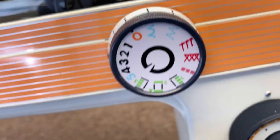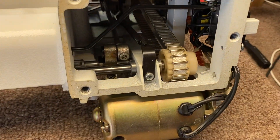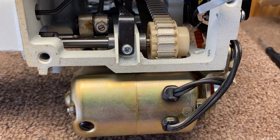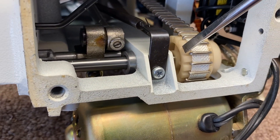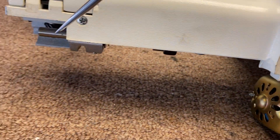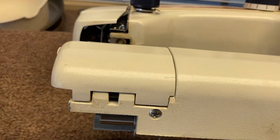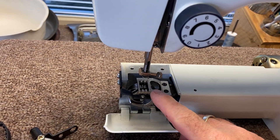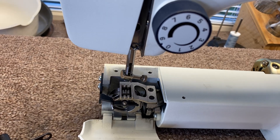The gear below is the corresponding gear with the upper one. You can see as it goes through the body there, it too has teeth for the gear. The lower shaft of the sewing machine goes across — it moves the hook, which is what forms the stitch, and the feed dogs, which pick up the fabric and move it through.